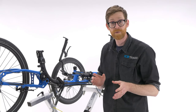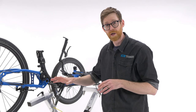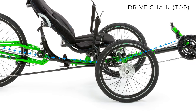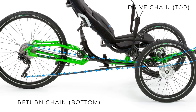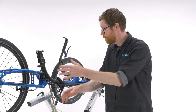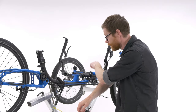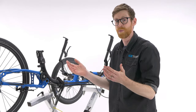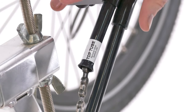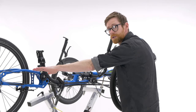Let me briefly explain what I mean by the top and bottom chain tubes. All chains on bikes or trikes have a top and a bottom chain. The top chain is the drive chain — it's under load as you pedal and pushes you forward. The bottom part is the return chain, returning from the pedals back to the rear. With a trike it's quite easy to get them the wrong way around, resulting in a figure of eight. Our chain tube sets have stickers at the front and back so you know which chain goes at the top and which at the bottom.